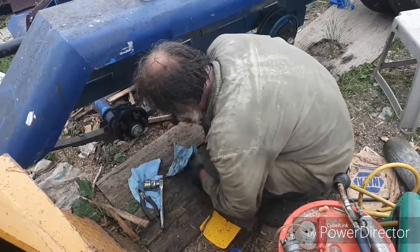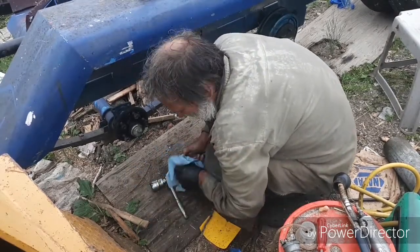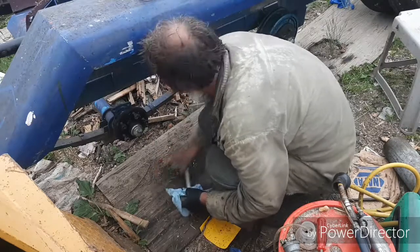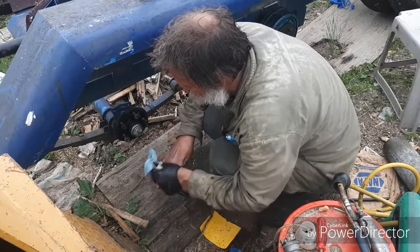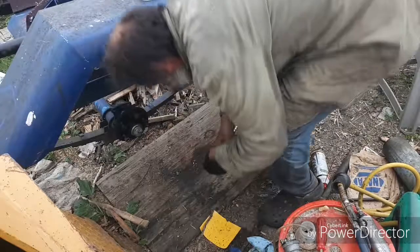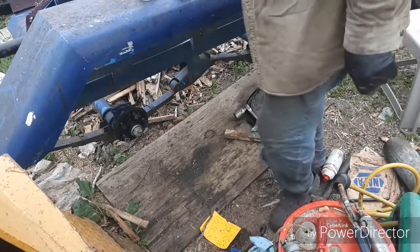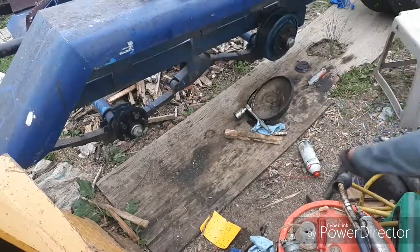And that's it. Now I have to start the forklift up in order to get the wheels on, to lift it up higher. I don't know if I'll be able to record anymore, but I just run the nuts on with the impact gun, and then when I set it on the ground, I torque them to 75 foot-pounds, just in case the thunderstorm hits me and I have to do it in the pouring rain. So unless I can do it, you'll see me put the tires on. If not, it's pouring rain and I have to get this done, and I can't record in the rain with my phone. Take care, guys.